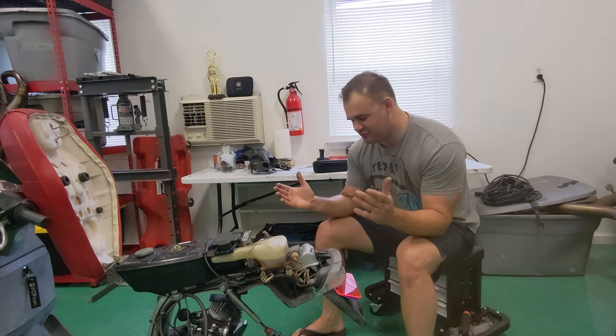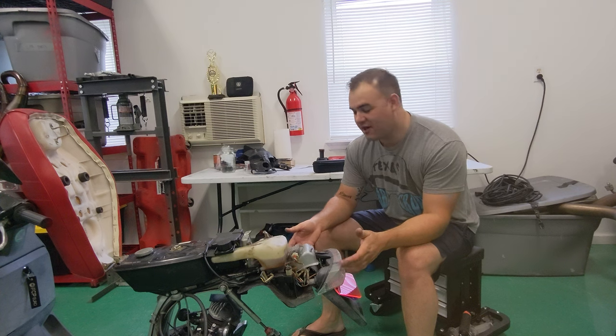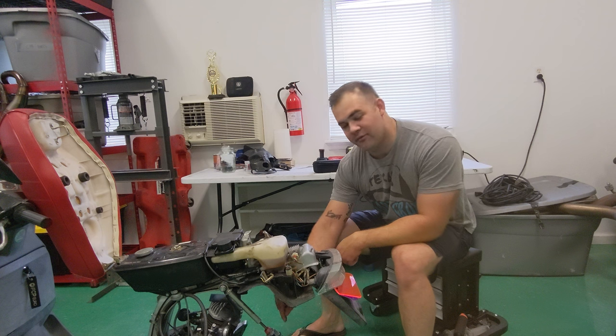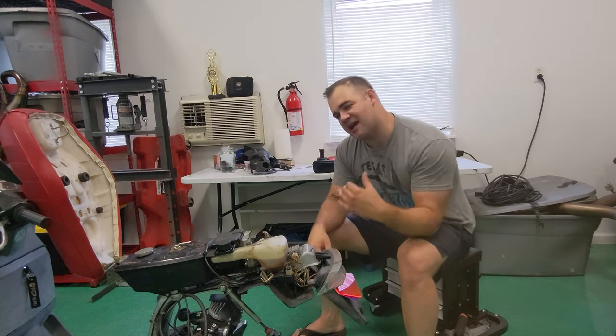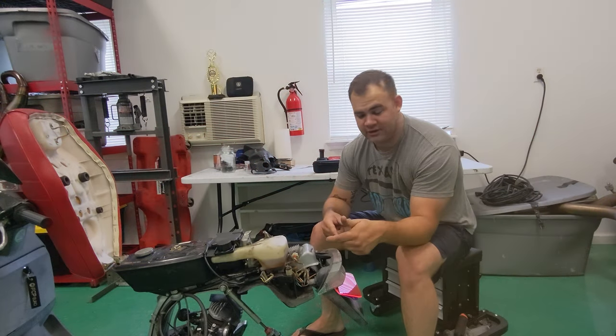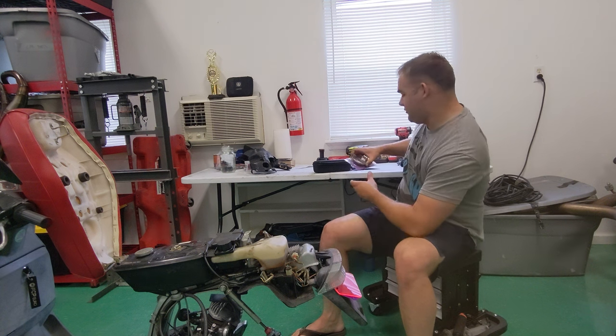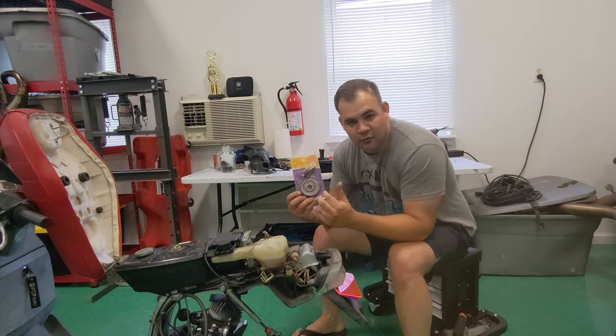That is due to my 12-to-1 gears, right? So for every 12 turns of the variator, I get one rotation of the wheel. And again, this kind of goes back to the mountain bike theory, right? That more rotations on the front and less rotations on the back means higher torque, right? So we'll be giving up a little bit of torque today, but we are switching to some 9.8-to-1 gears.